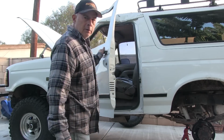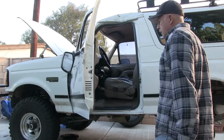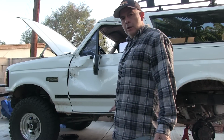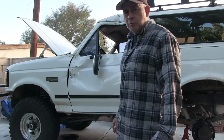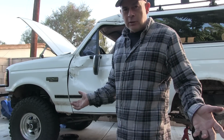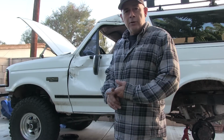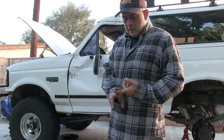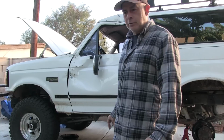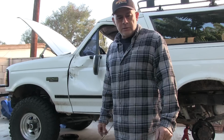Brakes are fine. The wheels, the axles spin freely. So that's good. What I'm doing now is I got to change the oil, only because we put all kinds of oil in there. It's what anybody had on them to donate to me. Once it was rolled over, the engine oil was low, so I put a quart of transmission fluid in there and some other oil. I had no idea what it was, but at least to get enough oil in there to start the motor and run it. So I'm changing that right now. That's just basic stuff.